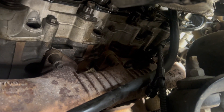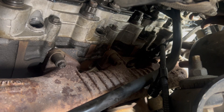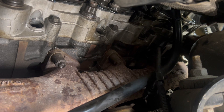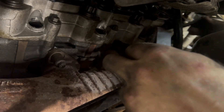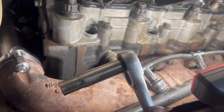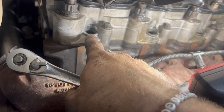So you got to let the truck back down. That is a very handy tool to have. Now your harness is off. I'm going to show y'all pulling the glow plugs here in a second. 10mm deep for getting your glow plug out. The tip is just right there.